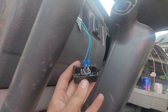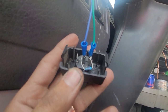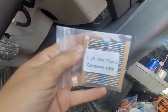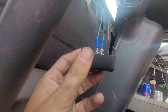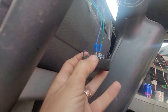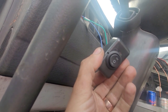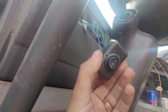To avoid that, all you have to do is put a resistor here between the two wires. It has to be a 1 kilo-ohm or bigger — this one is a 2 kilo-ohm, but it can also be a 5 kilo-ohm. What this does is when the computer checks for the 12 volts, it will be able to measure it even if you turn the fan on by breaking the connection. The computer can sense the 12 volts through the resistor, so it will not throw a code and will not keep the fan on when it doesn't need to be.